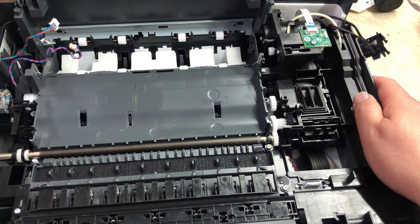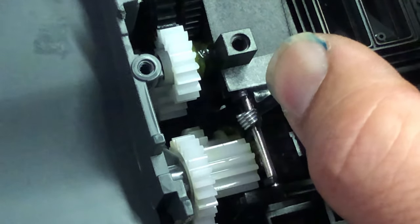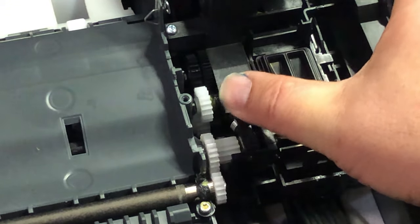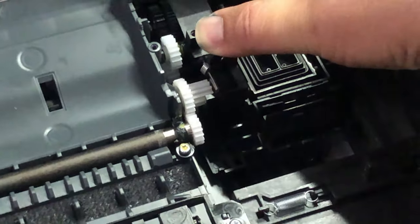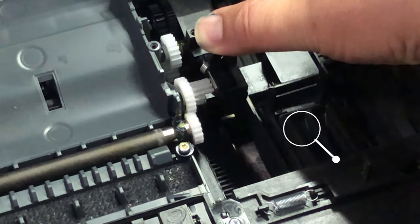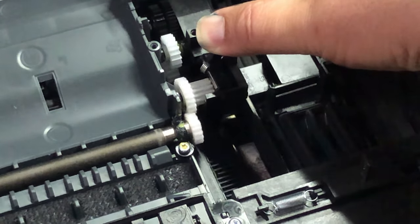You can see nothing happened. The trick is on this little lever right here. If I push the lever to the right, you can see there's a little gear underneath moving to the left. Now I'm holding this lever and turn the gear again. Counterclockwise going in and clockwise going out. We are not using the printer — it goes all the way out and releases the platform and seals the printhead. We call it a cap position.